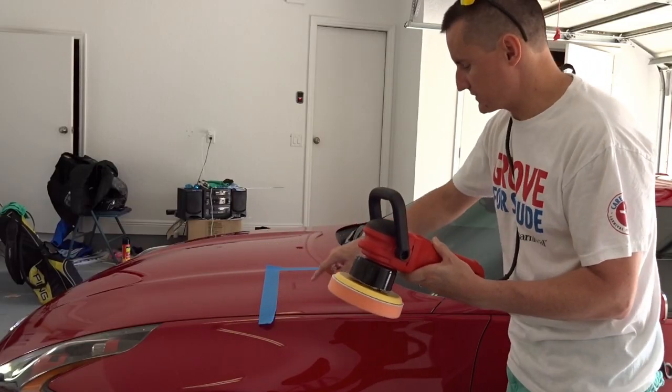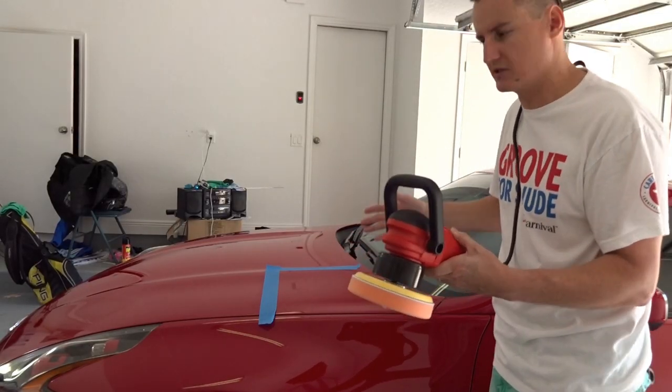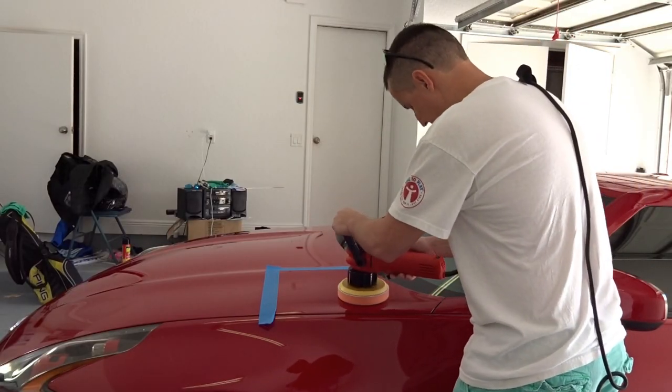Once over, remember the cross-hatch pattern? Back, forth, and just come back this way, because you want to keep overlapping. Do it about 6 times, usually is good enough. Pull it off, clean it off, and then see what you got. So once again, I'm down on the paint.